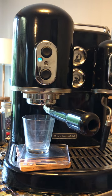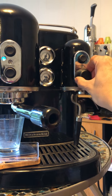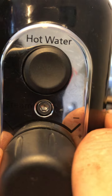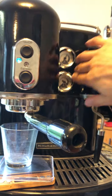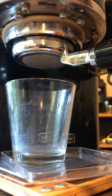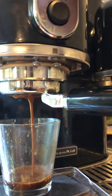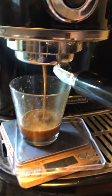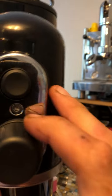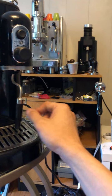When it's filled up, that's when it goes full bore. There's another trick if you want to bypass that feature: when you open this knob lightly, you can hear a click. When it clicks, the boiler gate is closed, so it will go into normal full bore pressure with no pre-infusion. When you click it back on, it's going to do that pre-filling again.